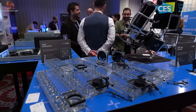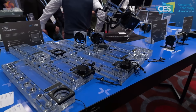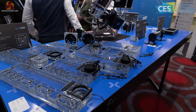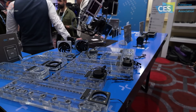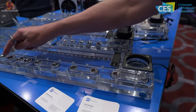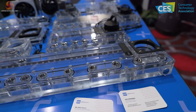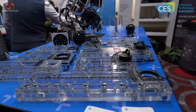Here we have a whole family of Core distro plates. These look absolutely amazing. There are two particular points to pick up on: one is that none of the G1/4 threads are just cut directly into the Plexi — they've all got inserted thread bosses, because if you go directly into the Plexi you will suffer cracking without doubt. So all this metal is a necessity. Furthermore, the Plexi has been machined so cleanly it almost looks like glass. It's an absolutely lovely piece of work, and they assure us this is the straight machine finish — not after polishing. This is how it comes out of the workshop.